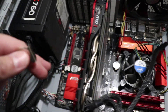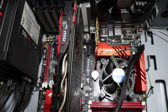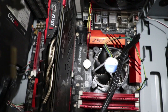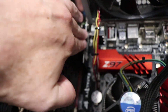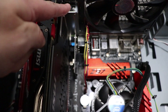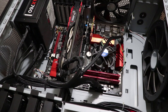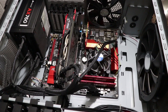The larger slots actually support upwards of closer to a gig, but this PCIe x1 slot will be efficient for me. You do want to know what you're plugging into — although the card is pretty much compatible with anything, you should check your motherboard specs to know your speeds and what generation of PCIe ports you're using. Once you get the card in place, just give it a push and it snaps right down into the slot. You can put the screw back in, or flip the plastic retention clip back down. Then we'll jump over and watch the speed comparison.